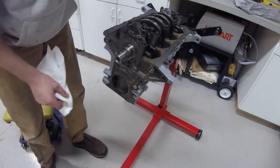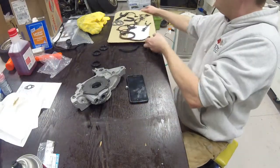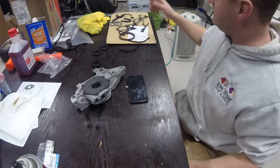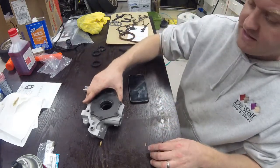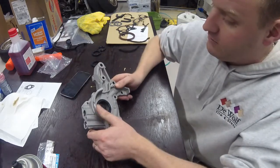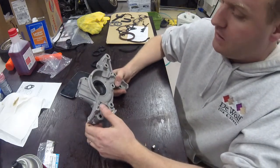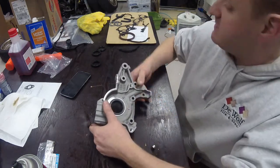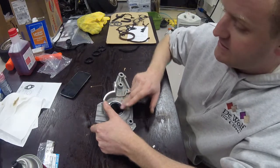I'm not going to put the rear plug in until later because it's being blocked by the engine stand mount. I have the OEM Mazda engine gasket kit — basically all the oil seals for the motor. I'm going to be using those during installation. My old pump is working fine but I went ahead and purchased a new Melling 191 oil pump for the Mazda Miata. The front main seal that comes with it I was going to replace with the Mazda OEM seal, but when I looked closely they are the exact same seal — they already use the OEM style seal in this pump.